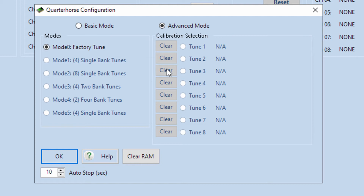So ultimately, you're probably going to want to have a nitrous tune and a non-nitrous tune at least. The other application sometimes is if you want to have an E85 tune and a pump gas tune, or a pump gas and a race gas tune, something like that. You might want to have a few different ones, but totally up to you. But most other cars and combos that are not nitrous, it's usually just one tune. If it's done well, you can just about get the best of everything in one tune. Drivability, good idle, good power, safe power, everything where it needs to be. So just letting you know there's some possibilities there.